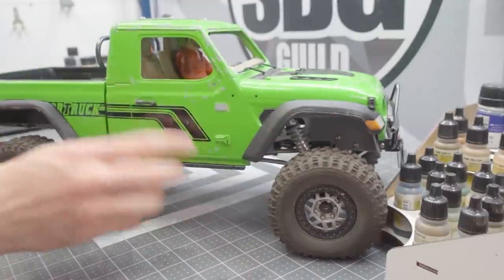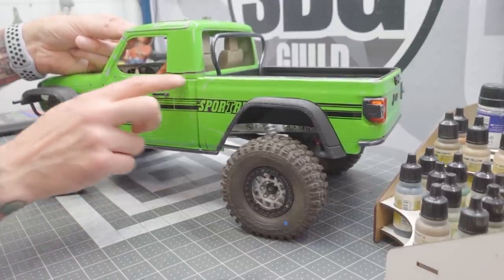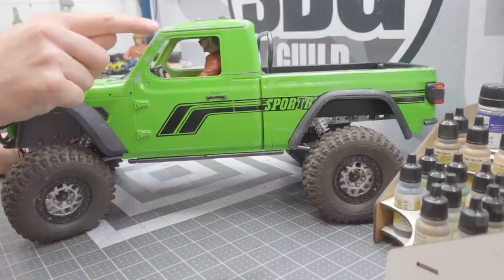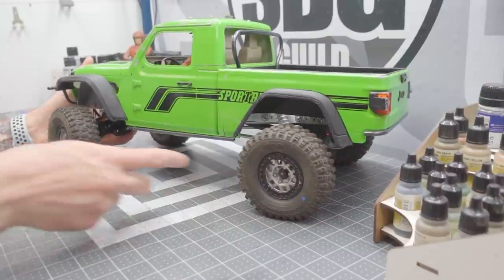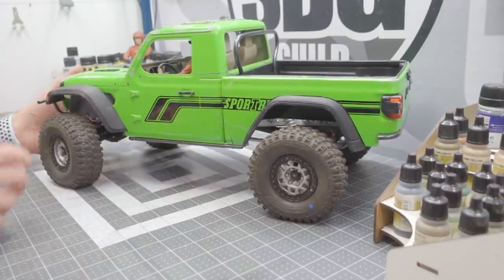Both door handles are still on the truck; this one's just holding on. I didn't do what I told Josh to do, and that's use glue and glaze to put all these windows in — I should have used glue and glaze, it's a lot better. Everything else held together — except for the roof. That is a bit of a problem. Very interestingly, this crack was not along the actual print lines; print lines were vertical for these pieces, so that was quite an aggressive hit. I'm pretty sure the hit was right on the front A pillar, which caused the whole thing to crack. It didn't crack all the way off though. There's also a pretty major structural crack in the bed. Otherwise it held together and stayed on the body. All of the fenders are intact and didn't come off. My plastic welding method seemed to work pretty well, and there were no mechanical failures.